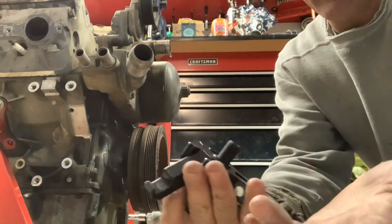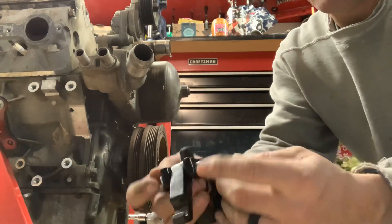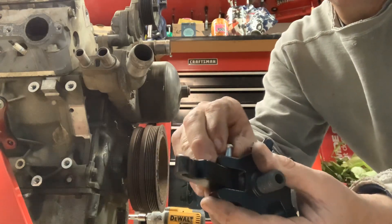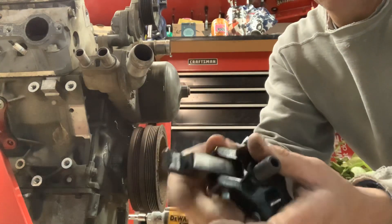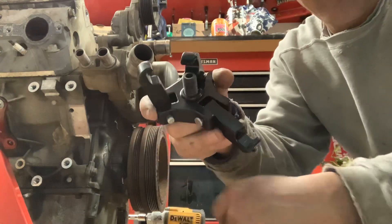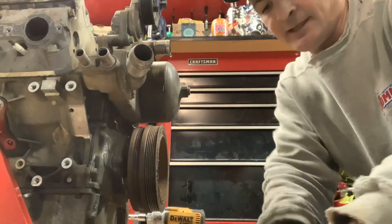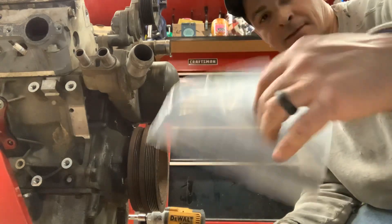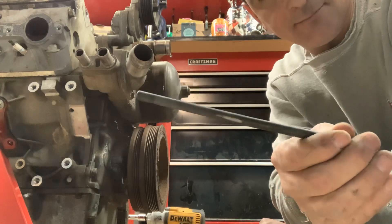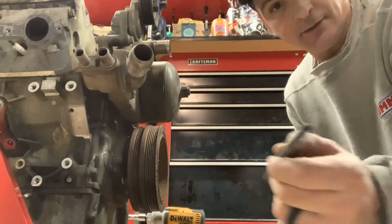You might say that's your regular jaw puller, but it's not — these pins can be popped out and switched around. For GM you need it just like this. It comes with a bag of rods; the longest one is the one you're going to use. As you can see, it's bent up pretty good — these things are on there pretty damn good.